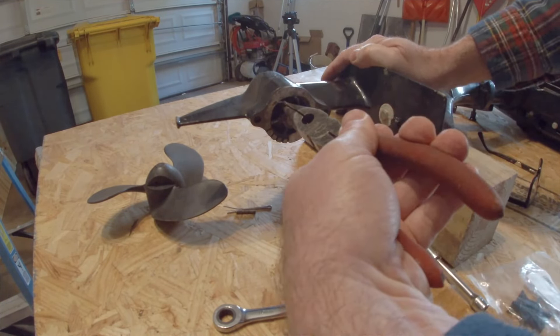Now there's a pin in here because this has a double keyway — it's got an indent on this side and on this side, because the pin goes through this shaft and that's what holds the impeller in place. My new impeller has the same thing. On first glance it looks like I got the right thing. I'm laying them on top of each other — the paths look the same, the fin length looks the same. Our new one is very firm; this old one feels pretty floppy and looks like it's made out of something thinner.